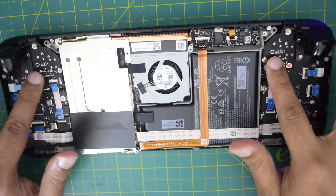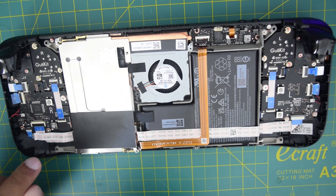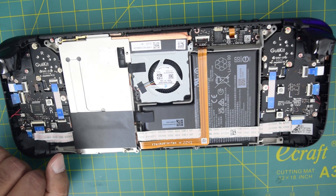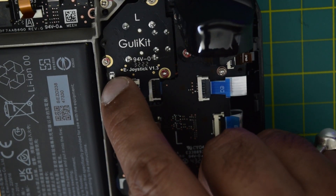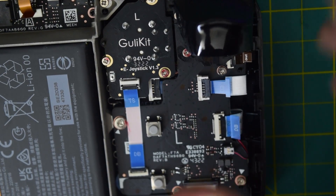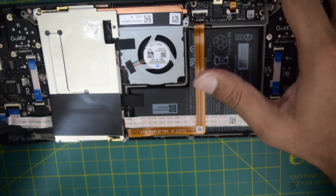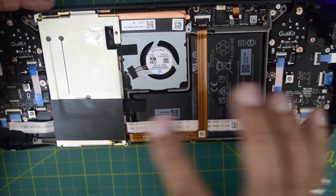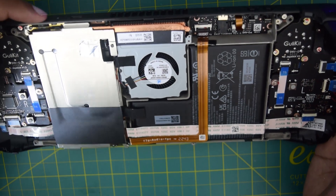Both triggers are properly installed. In my previous videos I have also shown how to install a 2TB SSD onto your Steam Deck — I will put the link in the description below. Now let's calibrate the new triggers. When you power this up, you'll need to press the small calibration button to calibrate your newly installed triggers so that your dead zones stay in place. Power the Steam Deck up using the power button. Leave the back side open — just be careful not to touch the plate as it will get hot since the processor is behind it.